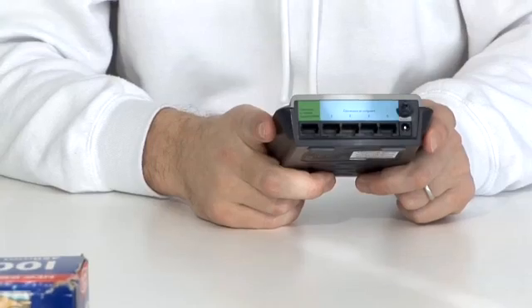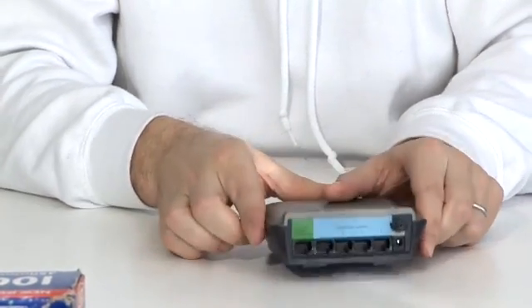The key to solving weak reception is higher signal strength and less network noise. Certain devices such as cordless phones and microwaves are obvious generators of wireless network noise. So if at all possible, keep your router as far away from these other devices and other things that could interfere.